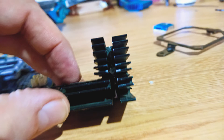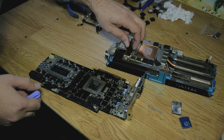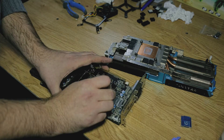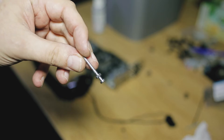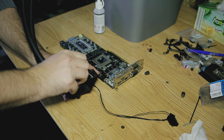This one I did off camera, but you can figure out for yourself how to make the cuts, since they are easy. I did have to make a groove for the heatsink to sit over some components. This depends from card to card if you have to do it or not. Reuse the thermal pads and install the heatsink. Now for the pump, I had to put a nut on the screw as a spacer because of the bracket's hole being so close to a rounded corner.